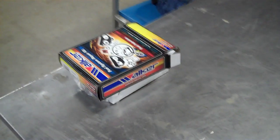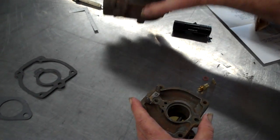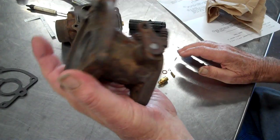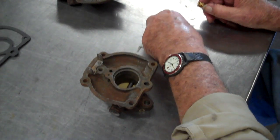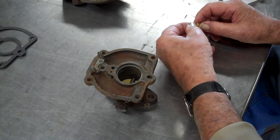There's the new carburetor kit. This is the bottom half of the carburetor. This is the top half where we put the float and the needle valve and seat in. This is the new needle valve and seat — that's about the first thing you put in on this top side.